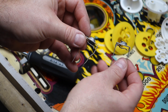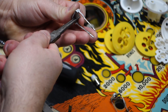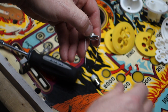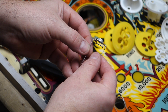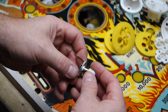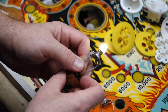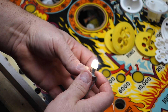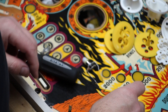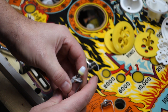See, this is factory and this is mine. Now since I took the bulb out again, I need to re-tweak it a little bit, because once you take the bulbs out you kind of have to do it over again. You put them back in and you actually bend it just a little bit. Now I've got that straight again going across versus the original style. When I put the bulb in there it's going to hold perfect pressure all the way across, and as long as I can hold it tight it's going to have good contact versus the factory one.